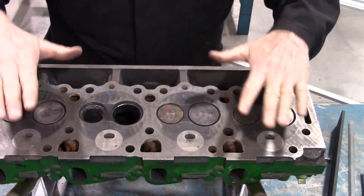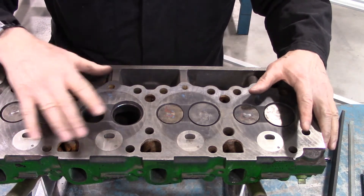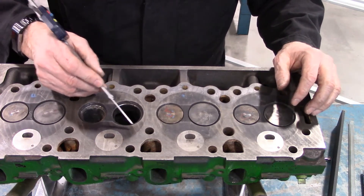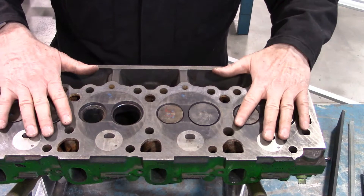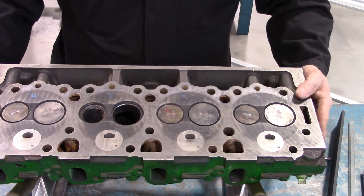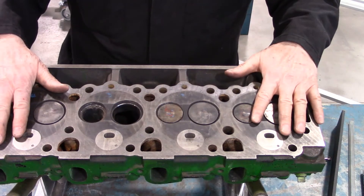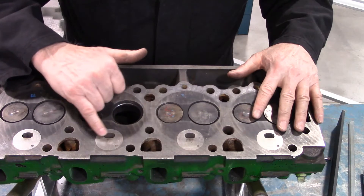Something else we want to check on the cylinder head before doing a whole bunch of work to it is just an inspection — look for places where there may be cracks. These tend to be in areas where components are very thin, or between a high-pressure area and a hole. If you don't have Magnaflux, you can have the head pressure tested: they put a sheet over it, pressurize a couple of the galleries, and submerge it in water to see if there are any air bubbles. Another method is to use dye penetrant — spray some on and see if any cracks are present.